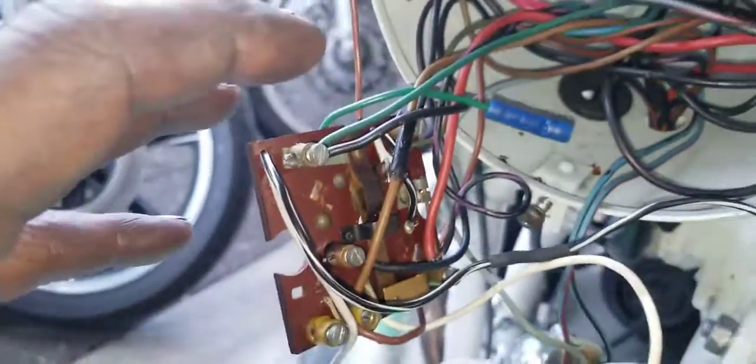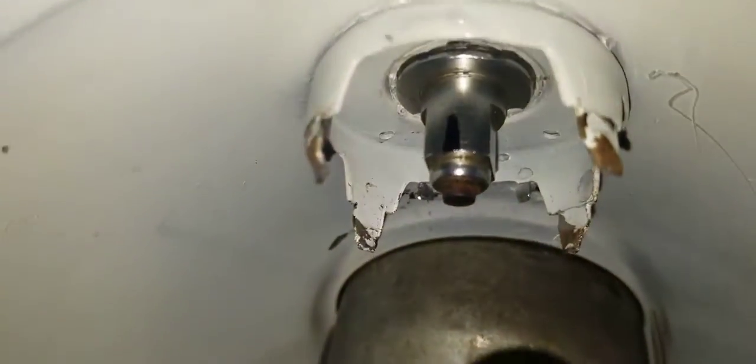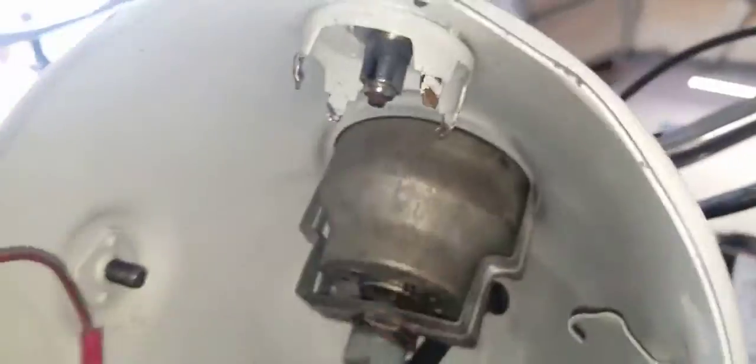Okay, so when this board goes up inside the headlight bucket, it mounts onto these tabs right here. So there's 1, 2, 3, and 4 consecutively. These tabs, literally just like tinfoil, they just get folded over and they hold the board up against the key switch, which you could see is we're looking at the under part of it here. So there's the top of the key switch, and here we are underneath it. And so those 4 tabs, right? They fold into position and they hold the board up inside. It actually goes like that, right? And it just mounts, right?